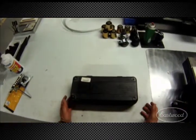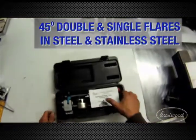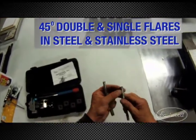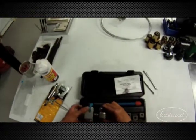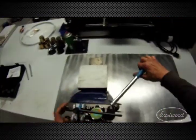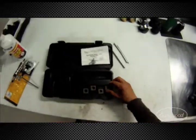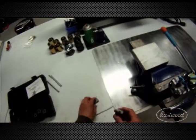Here's what you want — this is the Eastwood brake flaring tool. This is a professional tool. A lot of flares it can do. There's your standard 45 single. Very easy to use, set up to mount in a vise. Quick, easy setup. And what it uses is these different die blocks. This is set up for 3/16 — this is our line.